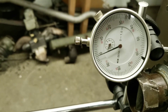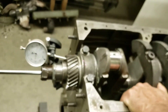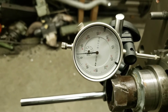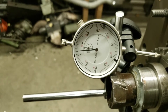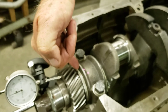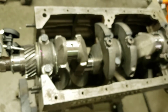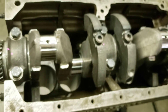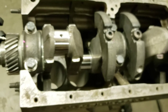You can see on the dial gauge we're about at zero. Then I'm just going to take a rubber mallet and tap it forward up against the thrust washer — and there we got about four thousandths. The spec is four to six thousandths, which gives you the oil clearance to go in here to lubricate that end-play thrust. That's how that adjustment works.